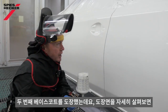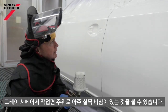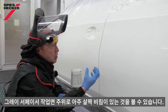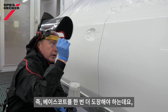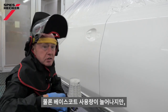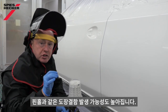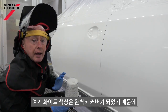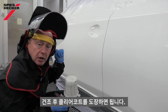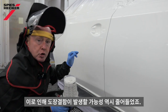That's the second base coat applied, and if I'm honest, I've almost got coverage there, but I have an area of uncertainty around the area of the grey filler, and I can just see it showing through very slightly. That means I need to put one more coat of base coat there, meaning increased base coat usage, but also an increased risk of defects such as pinholes. Whereas on the white, it's completely covered, meaning the job is now finished. I can get on with drying this and put my clear coat on, and I've greatly reduced the risk of any problems.